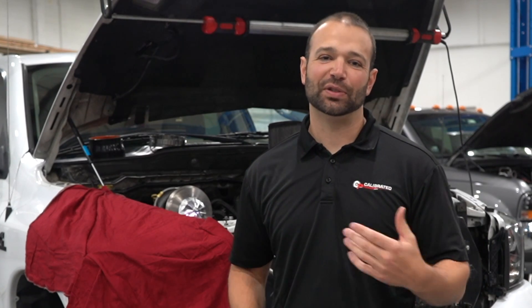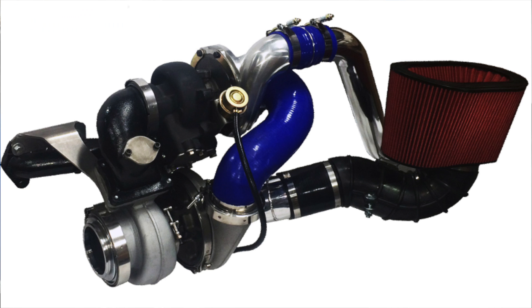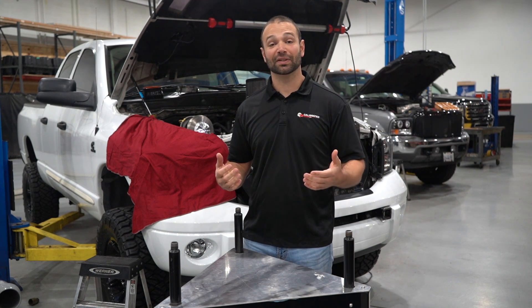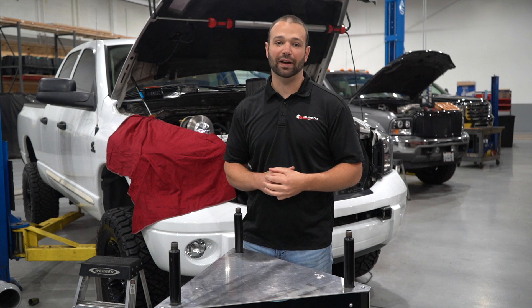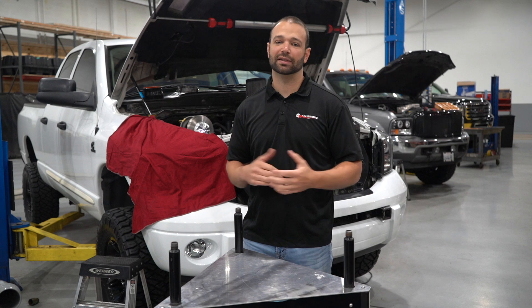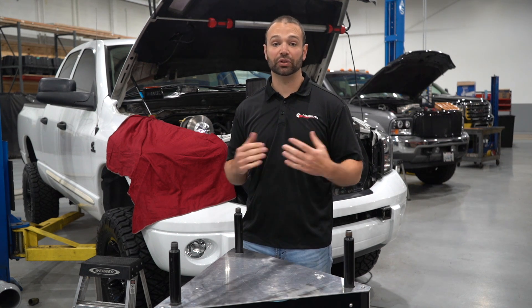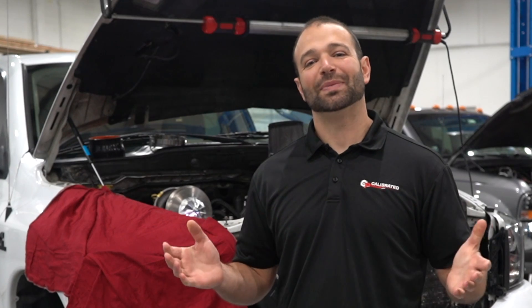Let's get into wheel sizing. There's an industry standard in the aftermarket: the Stocker Twin Kit. That means the stock turbocharger is used in the secondary location and an S475 is used in the primary location. The S475 is a monster — you can't beat it. It's cheap and it lasts. This kit is usually good for about 700 to 750 rear wheel horsepower on a Duramax, a little bit more on a Cummins. It's a nice kit — drives well, tows well, and it's reasonably inexpensive.